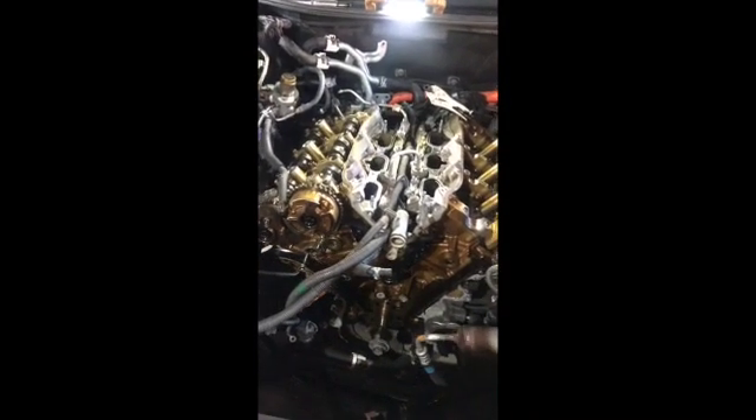Progress so far includes taking off the main chain. You can do that by taking some of the slack out of the tensioners and pushing the chain off from the crank spool at the bottom, then working it around. You'll need to make sure that the flat sides are aligned so that you can get the chain out, otherwise it gets stuck.